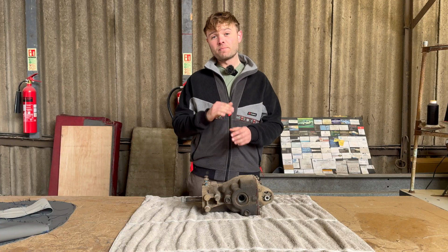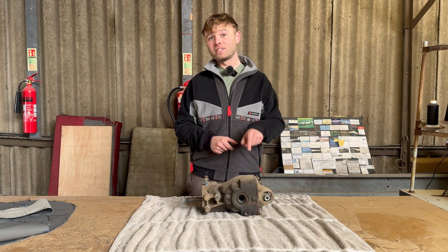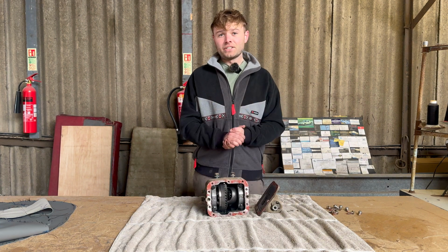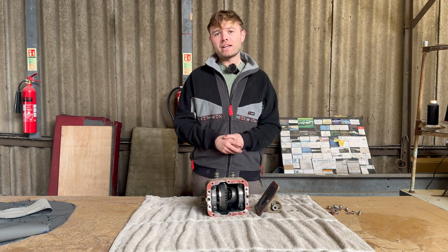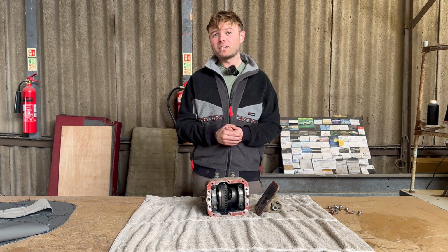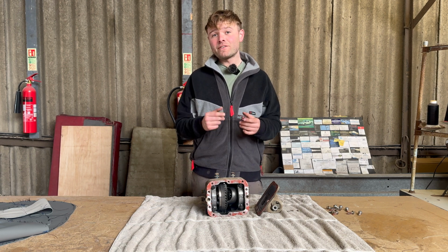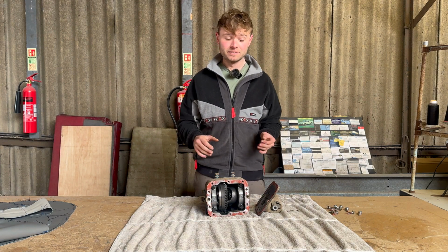And as quick as that, my four-wheel drive system was no more. And that's because something happened in my rear differential. So the next day, me and my mechanic Jamie got the car on the lift, removed the back cover off the differential to see what the damage was. And it was pretty catastrophic. Essentially, every single planetary gear inside my rear differential had exploded.